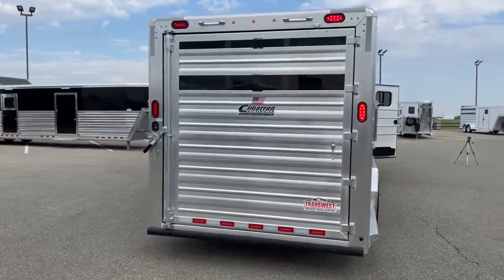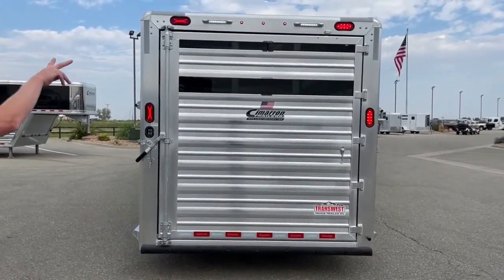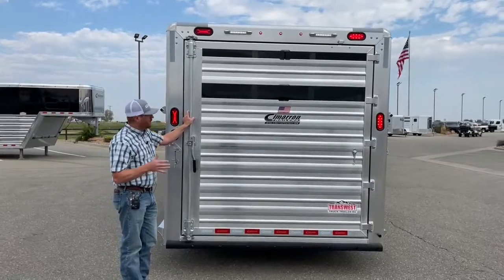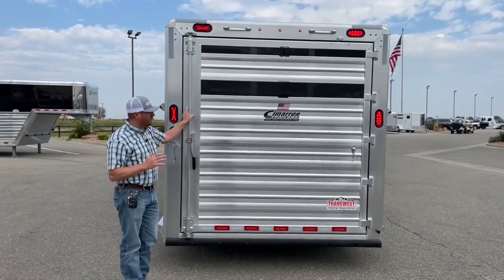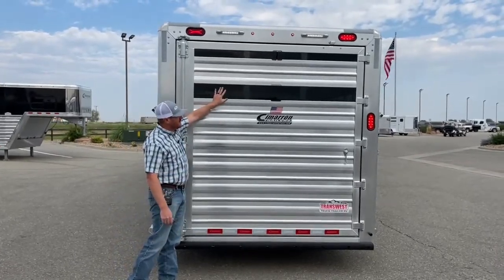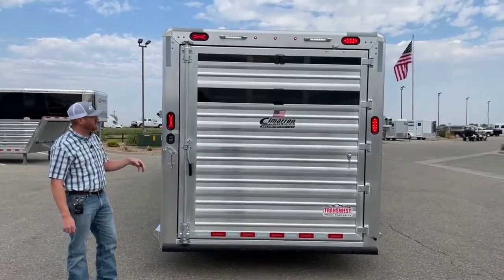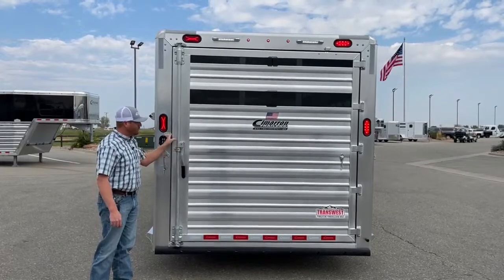As we get to the back, you can see a single gate with a nice big cam latch to the left, and two eight-inch awning lights similar to the one we just looked at, plus plexiglass in the back. Think about driving down dirt roads — that dust swirls at the back of the vehicle, and if we don't have the plexiglass in with those air gaps open, it sucks back into the trailer. Our animals get covered in dust, and more importantly they're breathing it. From a health standpoint we like to have the ability to put that plexiglass in at the back when driving those roads.